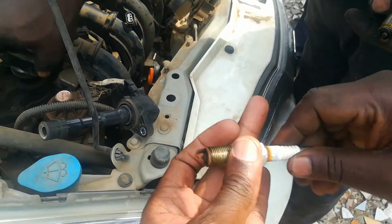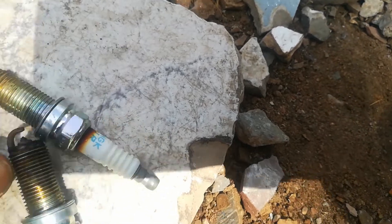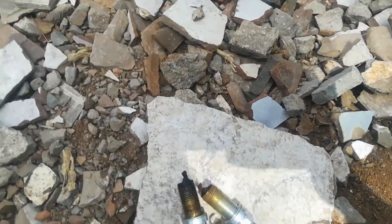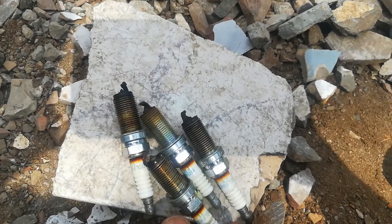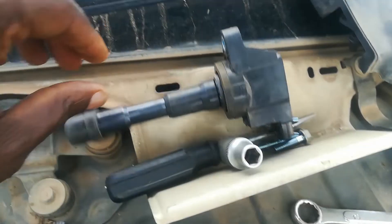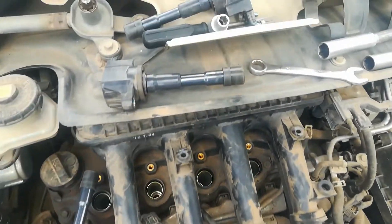The other spark plugs seem to be in better condition compared with number 2. So the cause of the misfiring was definitely in number 2. Our scan tool has perfectly diagnosed the problem, narrowing it down to cylinder number 2. But we cannot only replace one spark plug, so we'll go ahead and remove all of them. The coil packs right now appear to be in good condition, so we won't look into that. We start from the cheapest remedy and move upwards — cheapest but also the most common problem.